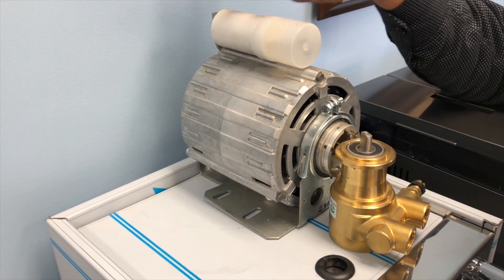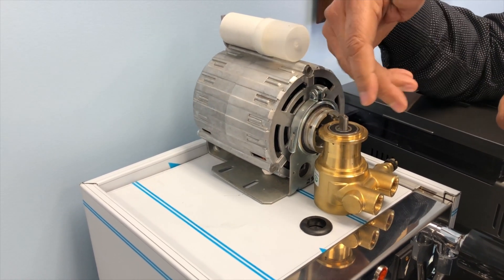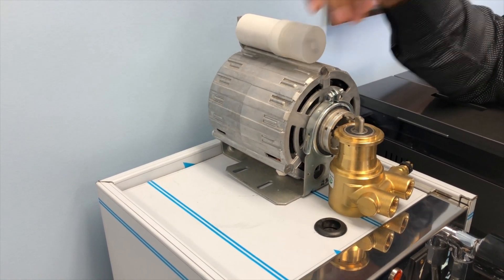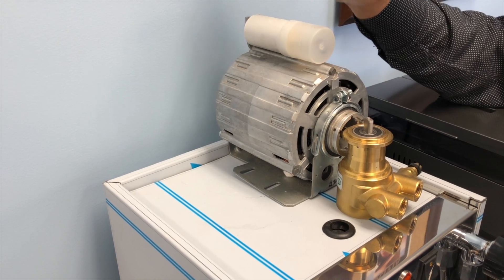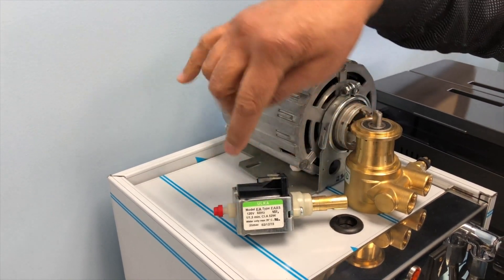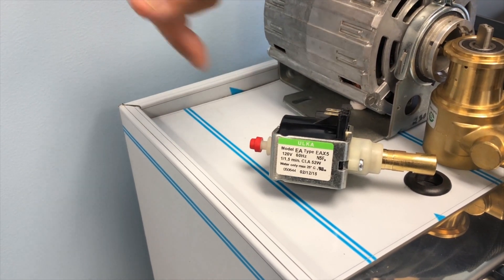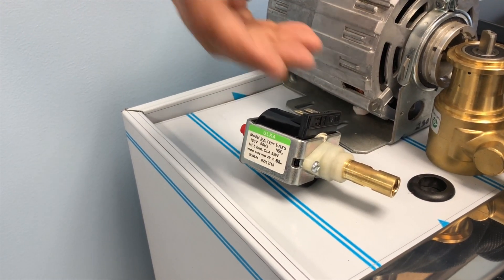Here in the USA, one of the conditions the health department will ask is whether the machine is connected with a no-return valve. This means if there is too much pressure in the boiler and the pump is not operated by the motor, the steam pressure can push the water back in the opposite direction and even out of the machine, so that water from the boiler can contaminate and go back into the water supply. This is one reason why the oscillating pump is better — it has only one pumping direction that cannot be reversed. It can suck water from the water tank and generate a maximum of 15 bar pressure, which is more than enough to extract espresso at nine bars.